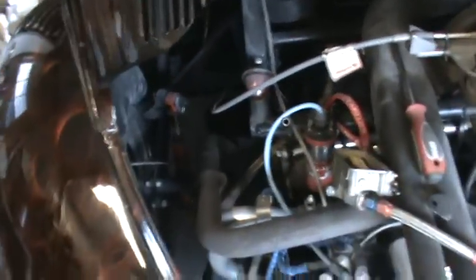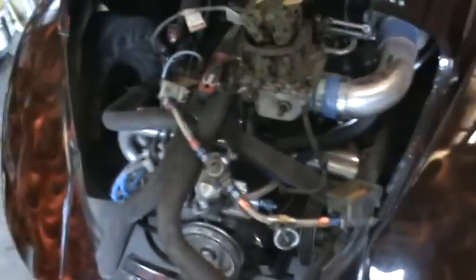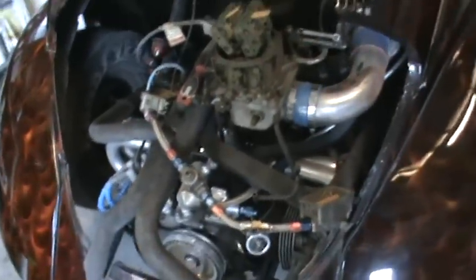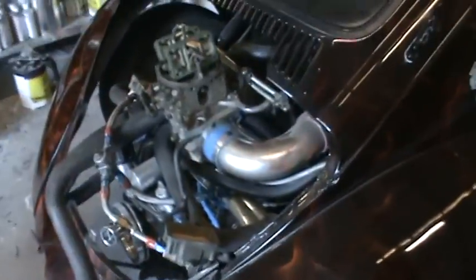There's the Oberg down there. I'm going to get the car jacked up and get that out — or actually just unbolt it and clean the screen. It traps particles down to about 3 microns, so you can check the condition of the motor and see if there's any bearing material or anything going on with the engine. It's a pretty cool system.